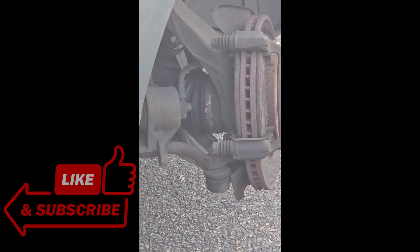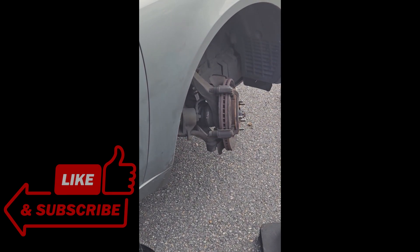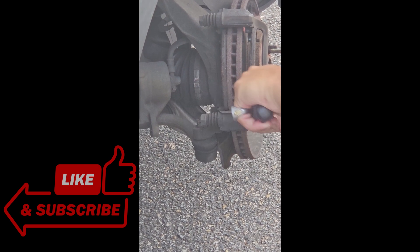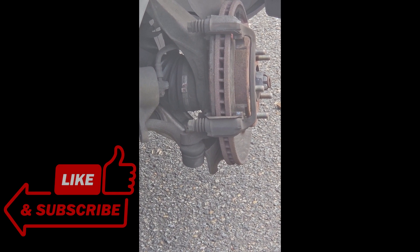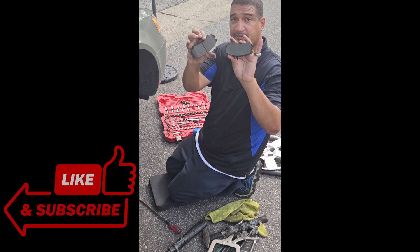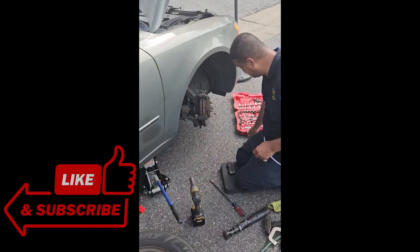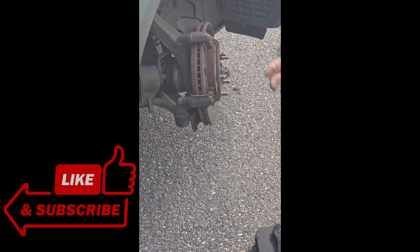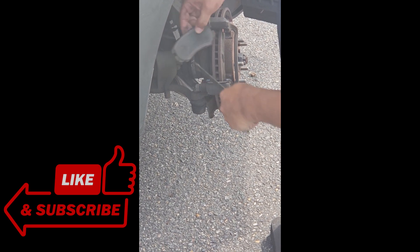What I like to do is lay the caliper right there on the car. Some people use a piece of string to hold it, but I have enough room. Now I'm going to take off the brakes — and this is going to tell you if you need new brakes. There's nothing. Metal to metal. We're going to go back to the steak theory. What do you see? What do you not see? Speaks for itself. So this customer will be getting a rotor within the first 30 days of the job, because we cannot warrant the job — whatever this pad is doing, the rotor is going to do the same.